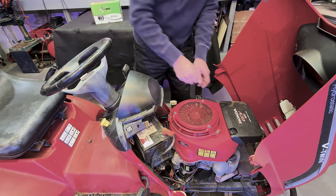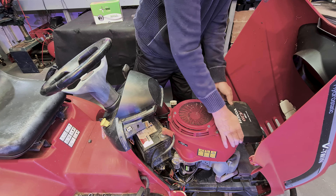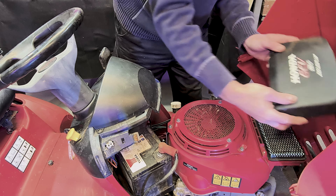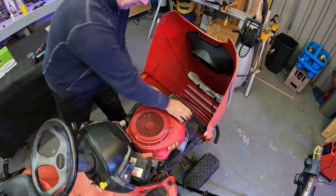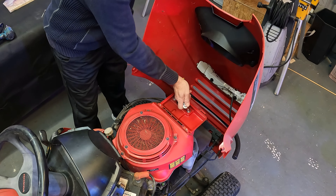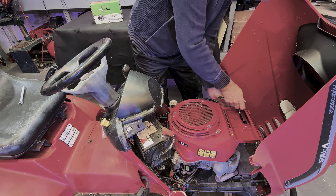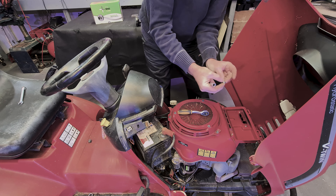Let's make a start on this. Let's pull out the air filter — anti-clockwise, these two. It just lifts up and hooks in like that. Now we're going to take out these two bolts. These are 10 mil. Okay, that's two out.